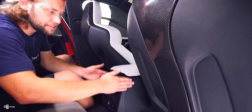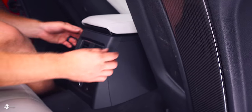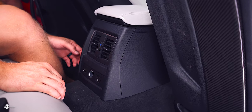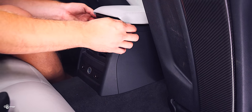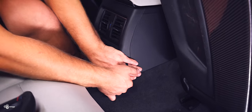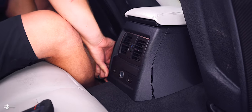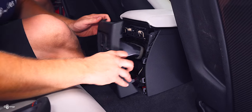When you're moving your seats up, this is the area that you need to clear. There's a pin that you're going to remove, so you don't have to put it all the way up, but it's good to put them up so you don't nick the back of your seat. Now it is time to remove this piece of trim. Some people like to start from the top — I feel like I'm going to rip my nails off if I do it like that. So if you go over here, you can get your fingers in and then very carefully pull back, then do the same on the other side, and just pull it out.